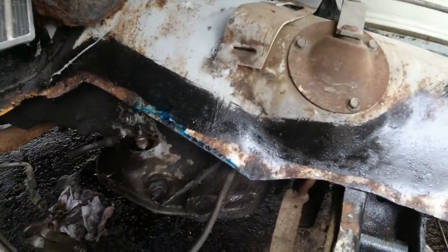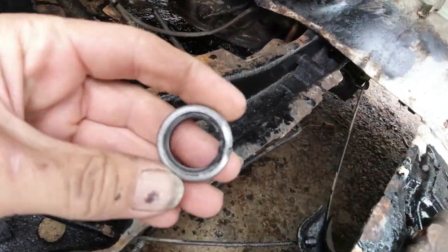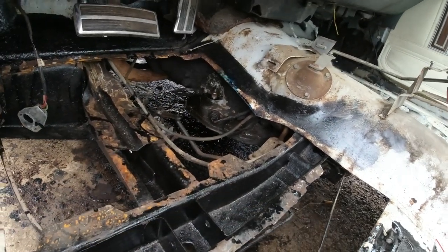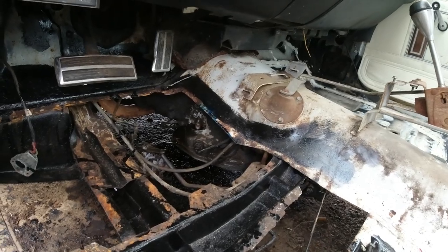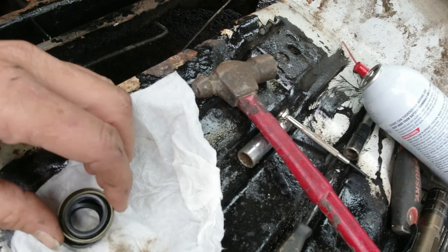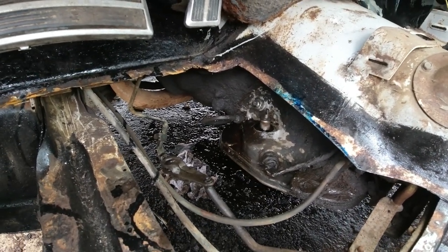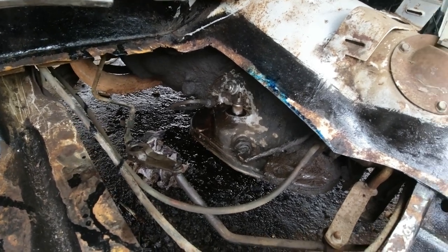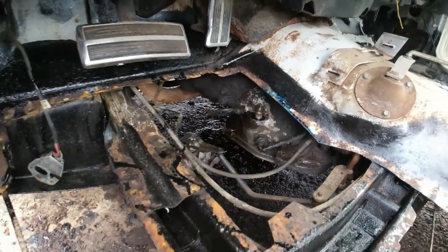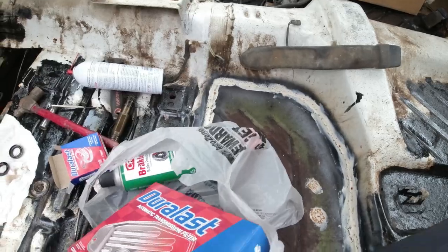I got that little seal out — you can see the linkage there. I had to get a screwdriver wedged in there to get it out. AutoZone had one in stock. Here's the new one — fixing to put that in there, looks to be the same. Hopefully that's what it is. I think it was a little bit low when I first got it started and I put in a quart or two — might have overfilled it, but even if it was overfilled it shouldn't be leaking out of there. Also bought a transmission pan gasket and filter for it — I'll do that later.